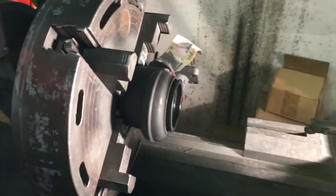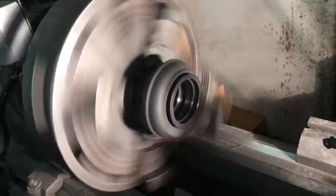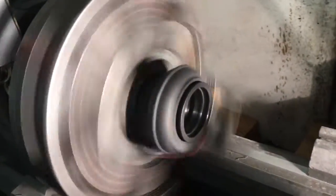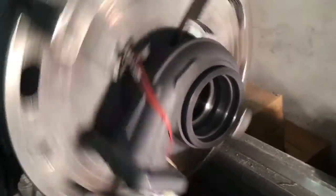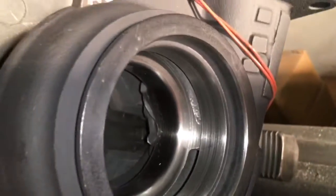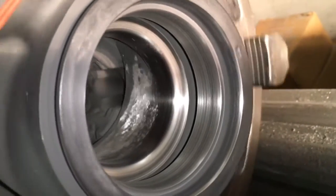The great thing about this turbine housing and wheel upgrade is that you don't have to machine your turbine housing any longer because you can just replace it. The problem with machining the original turbine housing is that it's really hard to line up on the machine, but once you have it lined up it's not that hard to machine. However, you do have to take a porting tool on the inside of the turbine housing to cut down the edges, because the housing was not made for that tall of a tip height of a turbine wheel.